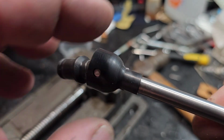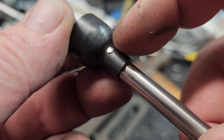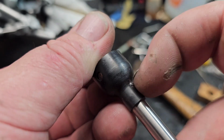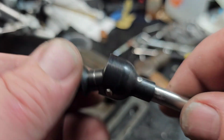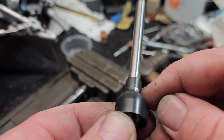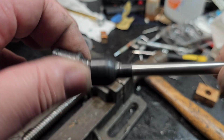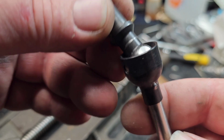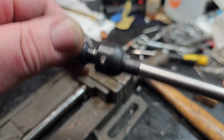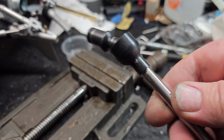In my eye, I properly prepped it. I roughed it up on the inside. I flared one end of this pin so it won't come out that way. JB welded it. Everything was roughed up, cleaned properly. So it should be grabbing on the main shaft, on what's left of the threads. I'm gonna bet that it never breaks, ever, on that pin. The universal will wear out before that shaft breaks, guarantee it.